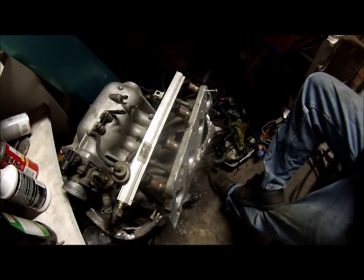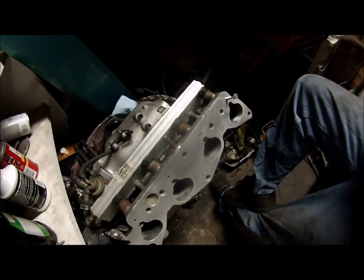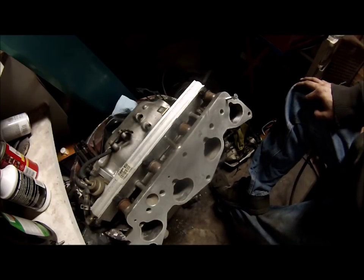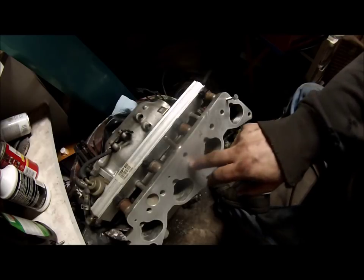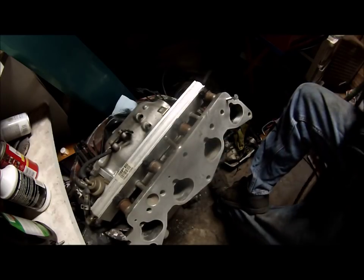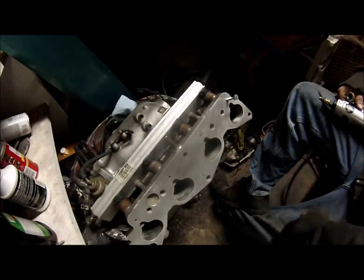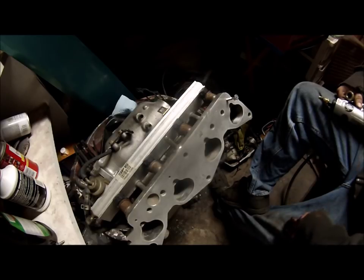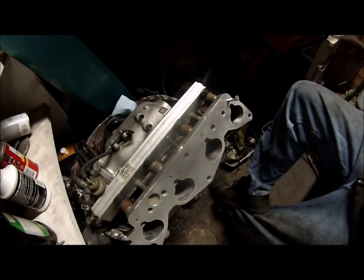Today I'm going to show you how to block off the air injection holes on a Y8 manifold. This isn't necessary for all Y8 manifolds, but if you don't have a 96 to 2000 this will come in handy, especially if you do a manifold swap. I do it on all of mine because I hate air injection holes. I usually take a bolt, thread it in till the bolt breaks off or I cut it off with an air grinder, then smooth it over with 80 grit sandpaper. Just to be safe I put a dab of gasket seal on when I put the intake gasket back on and it's golden — never have a leak. Right now that's where my leaks were coming from, the air injection holes, so I'm going to go ahead and do that and show you how I do it.